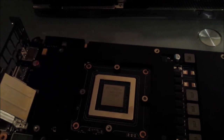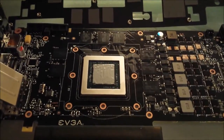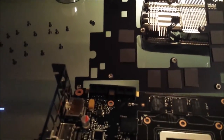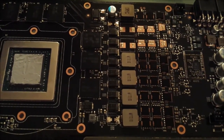Next, I'll put the thermal paste on and let you see how that looks, then we'll be putting on the new EK water block on the GTX 780. We've now applied the new thermal paste and removed this cover — it was just set on top. It's got all the thermal pads still on there, and we're going to apply the new thermal pads that came from EK over the VRAMs, MOSFETs, and drivers.